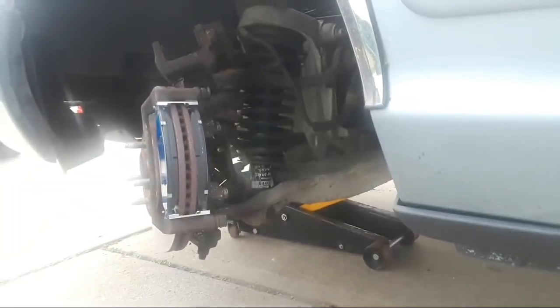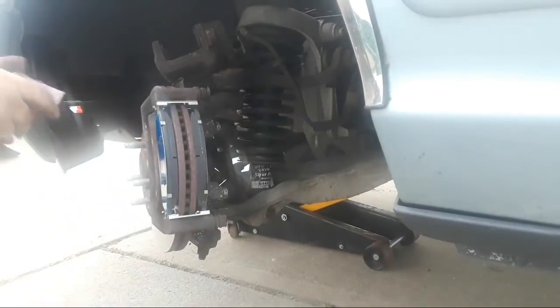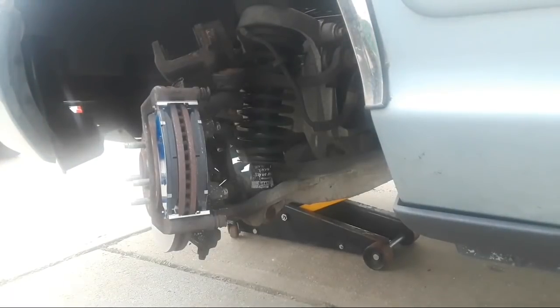Okay, now with my pads in place, I'm ready to install my brake caliper. Let me just wipe my hands off here. All right, as I don't want to get any goo on my freshly machined brake rotor. Alrighty. At this stage of the game, guys, I have 2 bolts that hold the caliper to the caliper saddle. I'm digging those out. Can they see what I'm doing?